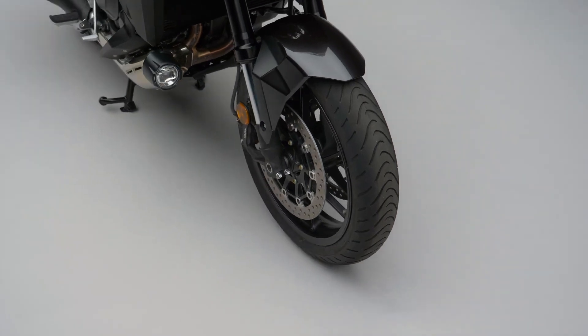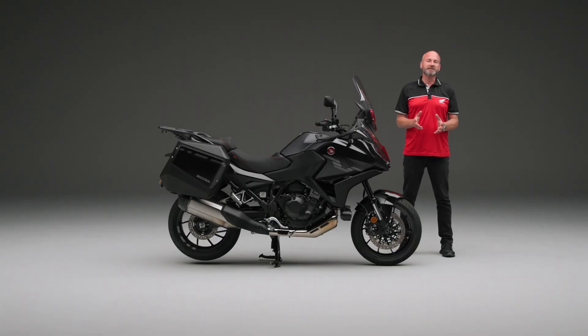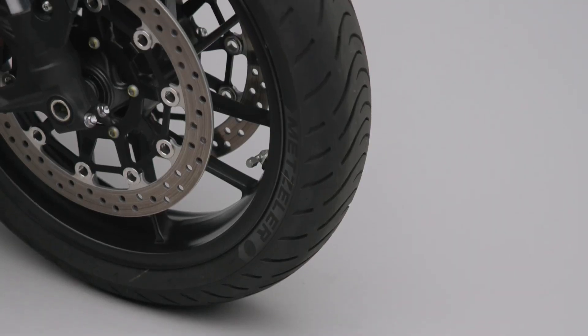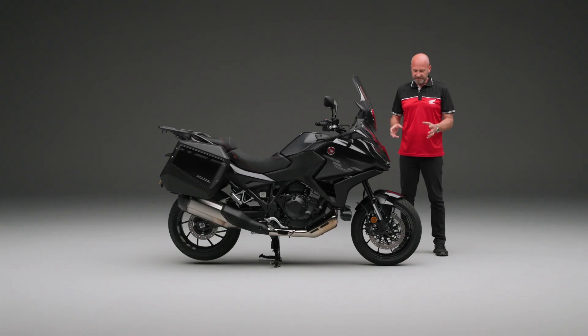If we look at the front, you'll notice we have a 17-inch wheel. That is the perfect balance, so that we've got good turning ability and equally good stability. The tyre itself is mounted onto the alloy wheel, which is fine die cast. All that means is that they can make the centre hub hollow, making it lighter weight, which again is a benefit to the riding of the machine.